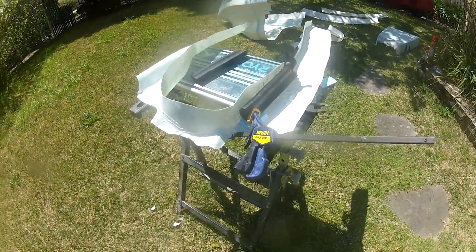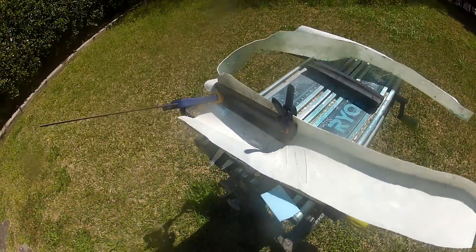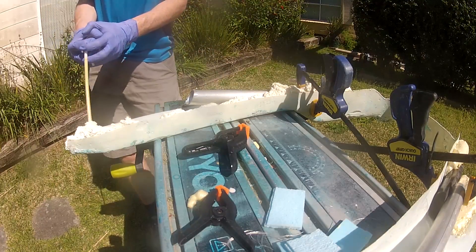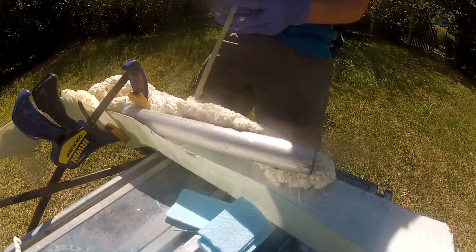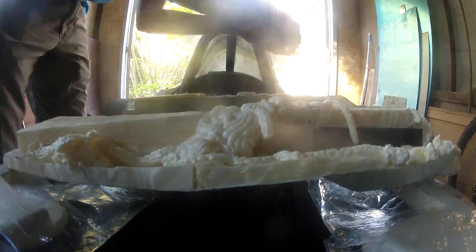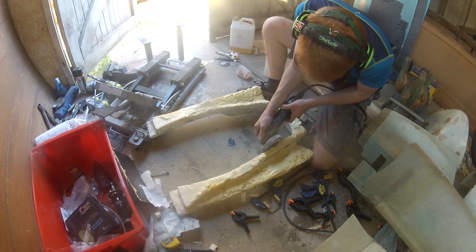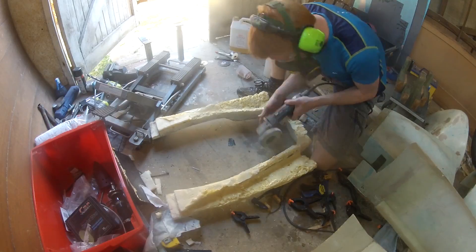The head shroud had to be removable so as to comply with the rules related to cockpit opening size. I decided to incorporate the mandated impact protection foam into the head shroud. I used pipes to stand in for the chassis members beside my head to position the impact protection foam correctly within the shroud. I then sprayed expanding foam into the part, creating a rigid piece. After cutting, trimming and sanding the foam back to shape, I laid fiberglass over it to completely seal the head shroud. Pins at the front retain it while still allowing easy removal, so the cover can be removed as a single piece quickly should I need to be extracted from the car in a hurry.